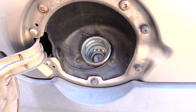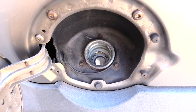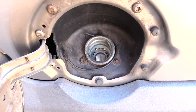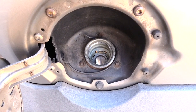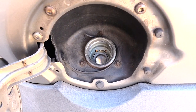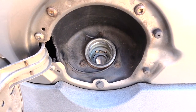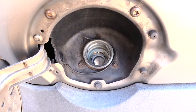This is how you would check your fuel pump on your vehicle, just in case your vehicle won't start and you think it could be a fuel pump issue. Also, before you think you need a new fuel pump, you should check your fuel pump fuse or relay — whichever one you have — to make sure that's not bad, because if that's bad it's not going to allow your fuel pump to work. So you want to check that as well.